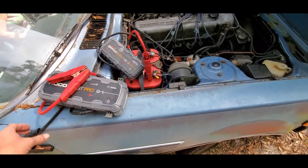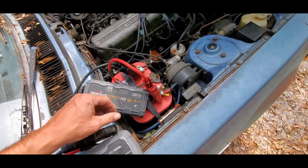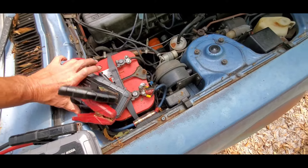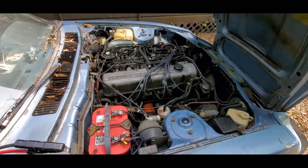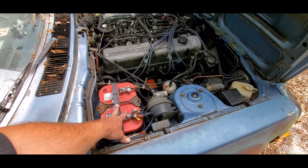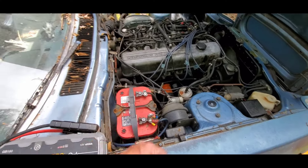Got interrupted by a call, but we shut the car off and it wouldn't start back up. In this situation, because she was letting the battery sit and the battery's three years old, I'd probably go ahead and get a new battery. She asked if I think it's the alternator — and as you guys have seen, the alternator did dip down a few times, but with everything disconnected and knowing that the battery is completely drained, the alternator is still doing its job. There's no fluctuating at idle — it's still running strong.